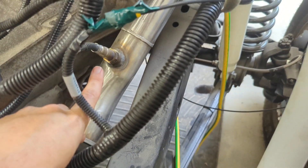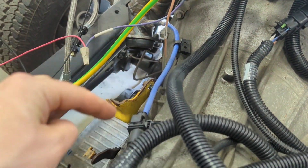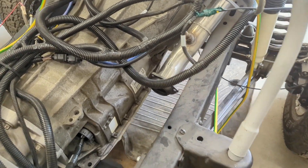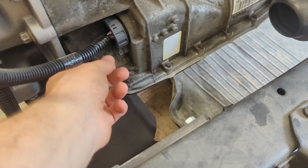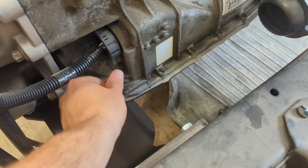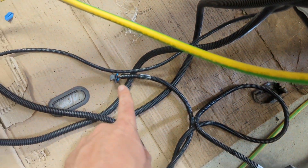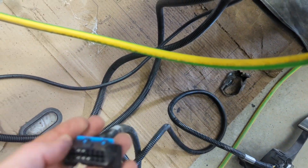Connect both O2 sensors — here's one O2 sensor plugged in here, and the other O2 sensor plugged in here. It's very possible I have bank one swapped for bank two, so that could be an issue. The other major connection is the transmission connection — plug it in and push this little ring down tight, and that draws it in. You can see here is the OBD port, so you can use that as an initial diagnostic — plug in a scan tool and see actual RPM signal when it's cranking.